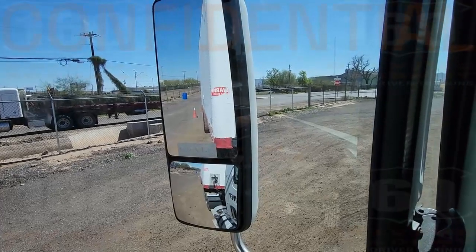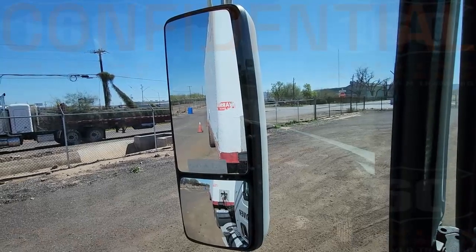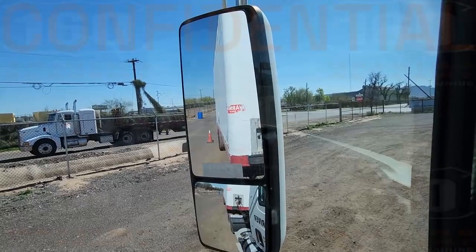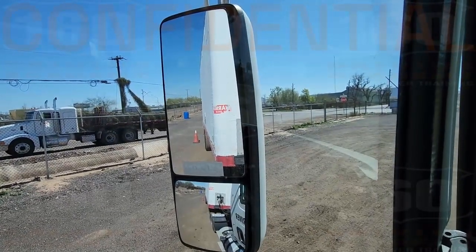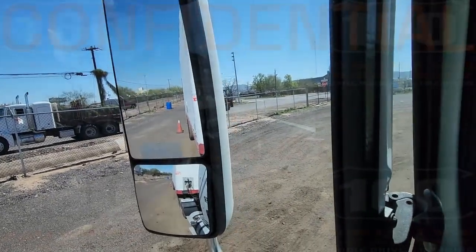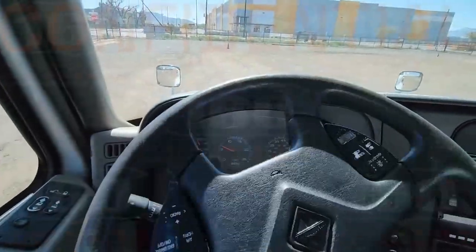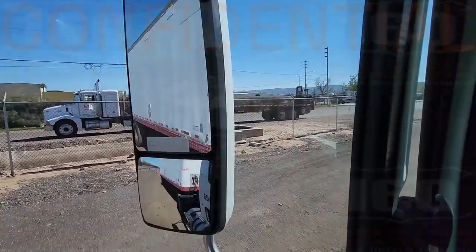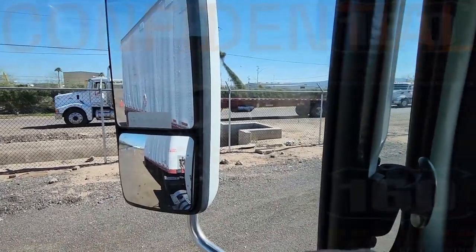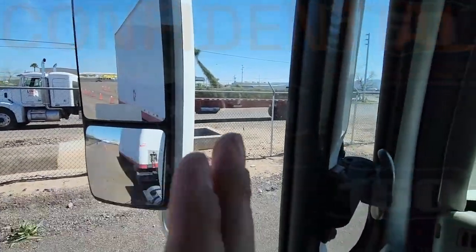Scenario, your angle is off as you're coming into the entrance of the lane. This is an example of an angle that's a little off. You can hop out, have a look safely, make a plan, and adjust for it there. Pull up. I'm doing wheel left all the way. Initially, this catches up the trailer, so it's straight with the lane. My objective is to lead the trailer wheels over more to the left.